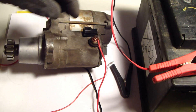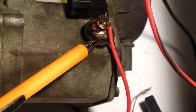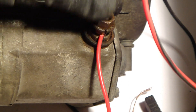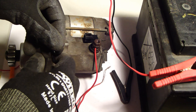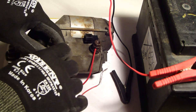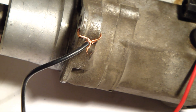I connect the plus cable here carefully so the red cable parts only go in the plus area, not the minus area. Then I have the next cable which is minus, and minus always goes to the ground — the cover area — and I insert that in here. This is also a good test to see if the starter is working. The connection must be tight and not loose.